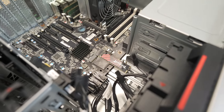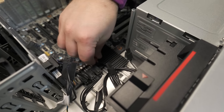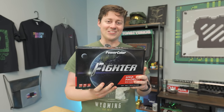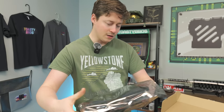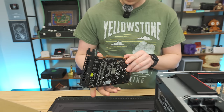Put the heatsink back on by starting with the hinges first, hooking under both of them, pushing down on the little red spring, and the heatsink is reinstalled. The SSD is in there — good to go and ready to take Windows. Now we have to install our GPU. These systems can fit most three-fan cards, but we went with one of the cheapest RX 6600s you can buy. You pull up and this kind of hinges over, and you'll line up the PCIe slot.